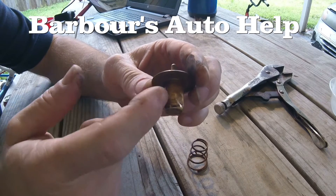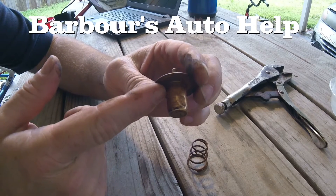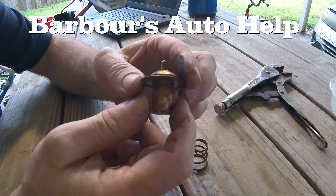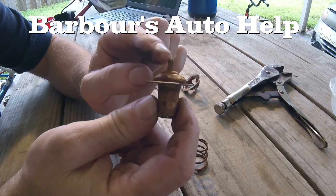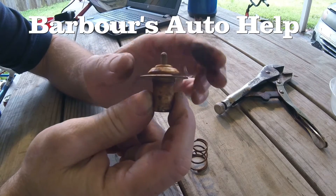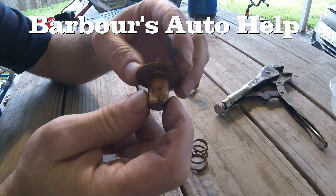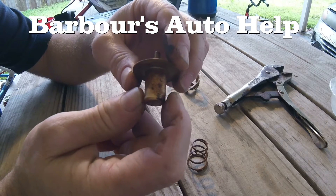So this is that cylinder, and inside there there's a piston. On the bottom here is a bunch of wax, and that wax when it expands pushes this little piston up right here. That's what overcomes that spring. I'm going to try to get into there and actually show you the inside of that heat motor.